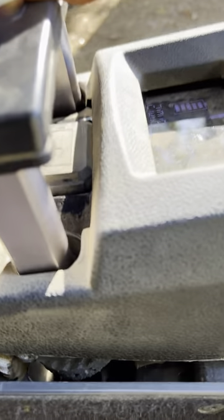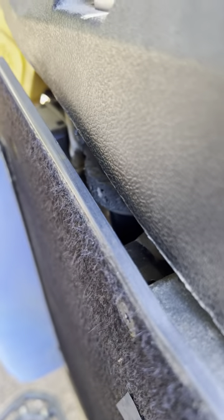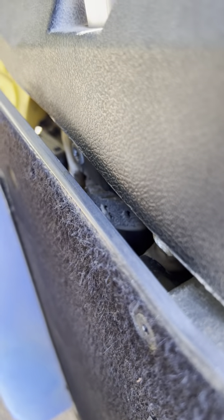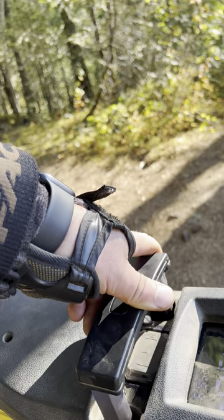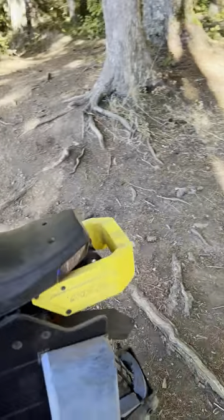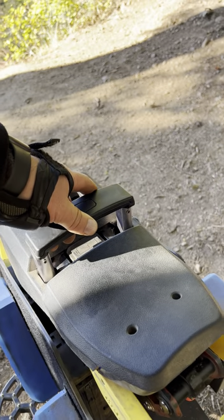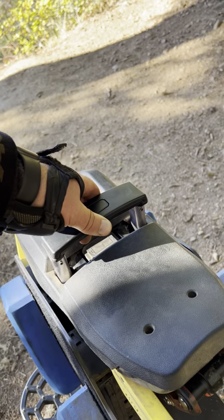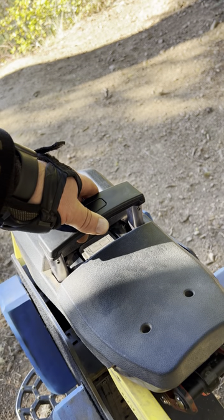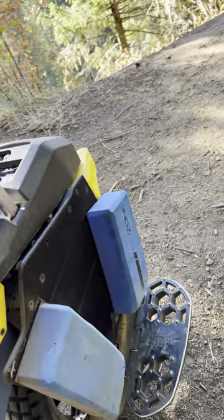You can see the bushing again from here — that chunk of rubber with the holes in the side. It's about a half inch wide, so I actually lost an inch of travel, but it's totally worth it to not have the slamming. The slamming — I mean, sure, the suspension is good for reducing banging on all the electrical components, but is it better when it slams like it does all the time? I just couldn't ride it knowing it was banging that hard.